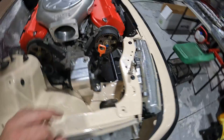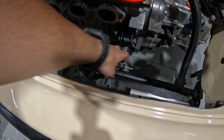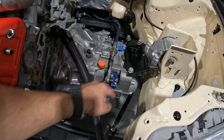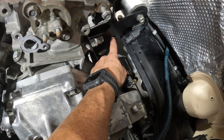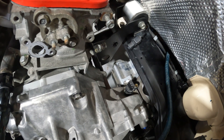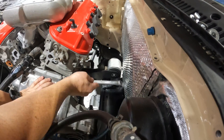We got our plan. One thing I'm noticing is trying to get a clear path for the exhaust. The radiator is pitched back nice and flat against the surface, we're at zero degrees, so we'll have a good amount of room to come through there. We got the shift cable in for our sequential gearbox. Right now I'm focusing on this rear motor mount — I want to be able to put a pipe through there, maybe even two. I think the best way is to get rid of the lower half and do some pipe work inside. So first I need to get a floor jack under the back of the transmission, unbolt that, and see what we can do on the bench.